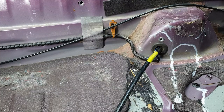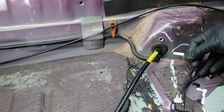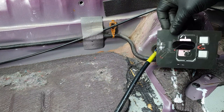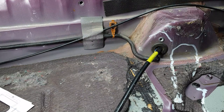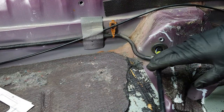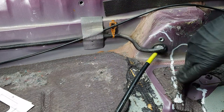Normally at this point when you remove this, you'll have two handbrake cables coming in here that were for your drums. And they would have had rubber grommets that were a similar shape to this. This is a template I made from the handbrake cables I ordered off Rock Auto, these ones here. So for the left-hand side of the car, which is this one, I've reused the grommet that was using some sort of electrical connection. I'm not really sure where that goes to, but whatever.